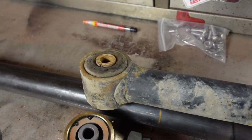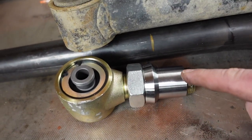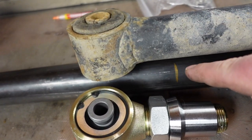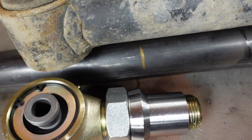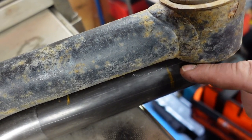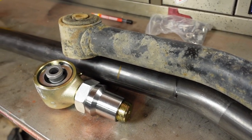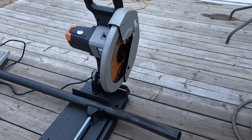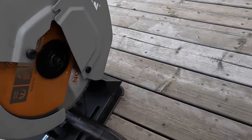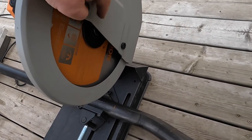I've got the old Rough Country lower control arm as reference, marking it out because I'm using a Johnny joint here and trying to line it up. I want to keep the thread as short as possible. Then lining up where I'm going to cut the two-inch tube in order to weld the new joint on. I've got the Evolution chop saw lined up — probably should throw that guard on there.